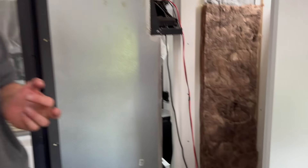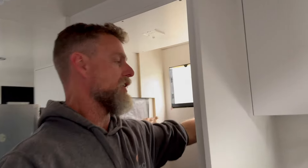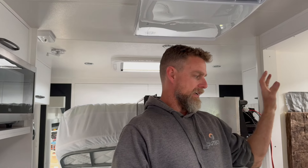There's no conduit, no duct, and no supporting of the cables — the cables are literally just hanging off their own weight. I guess the problem is that this is 12 volt equipment and there's not really any standard to be followed from a 12 volt perspective. But this van also has 240 volt inside it, so it should be installed in an appropriate manner to make it safe.